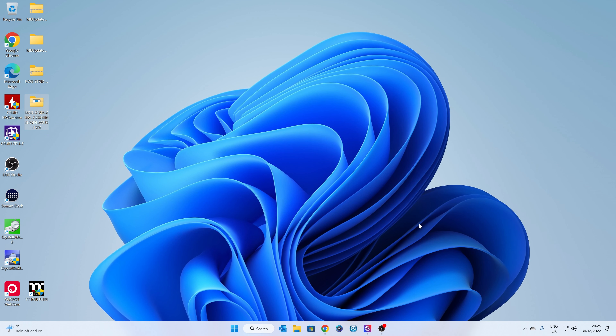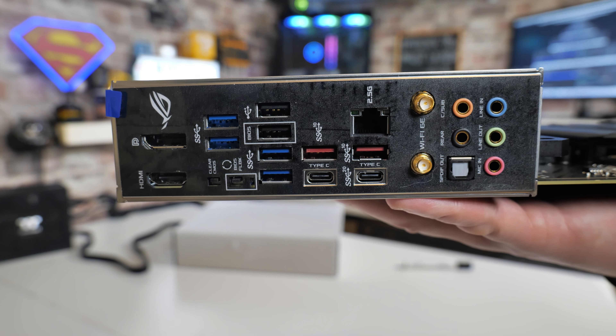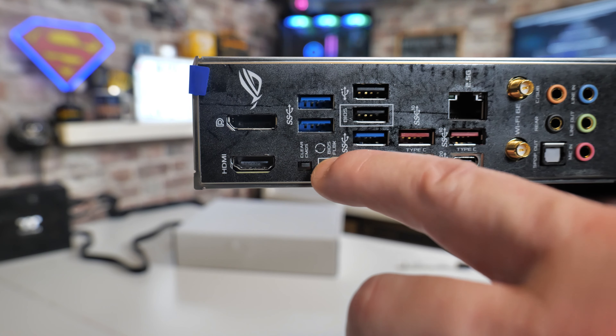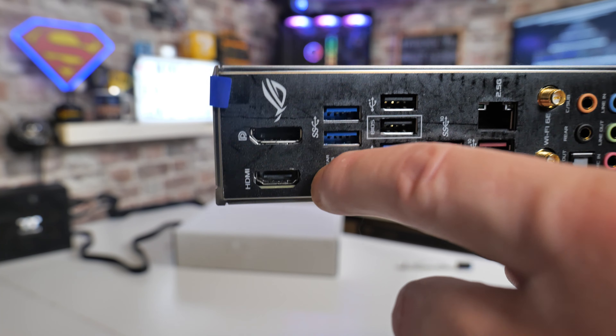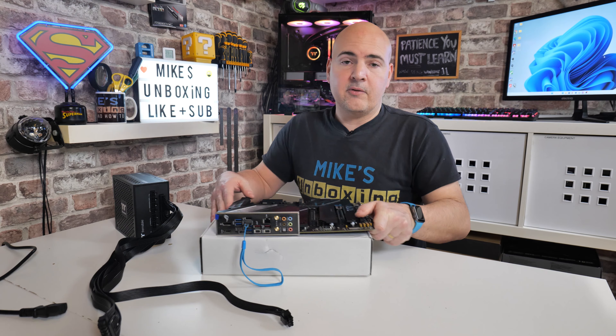We're all good to go. Insert the USB stick into the motherboard. On the back of the motherboard you can see it's highlighted with a white rectangle around the outside edge of the correct port for the USB BIOS update. Just below that is the BIOS Flashback button, also with a white rectangle around it. Just above it is the Clear CMOS button — don't press that one, you want the BIOS Flashback button. Insert the USB drive.